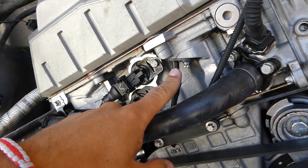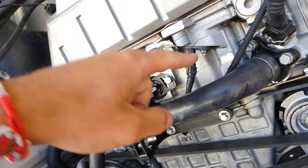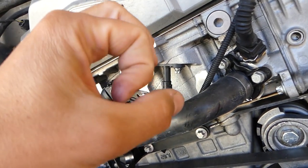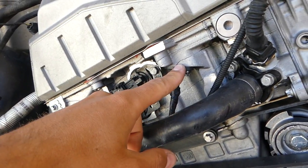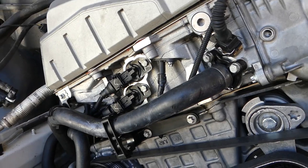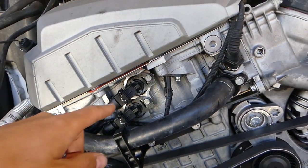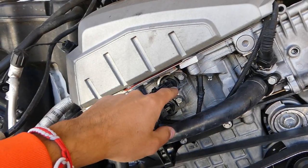After that, you can see this is the camshaft position sensor on the intake cam, and this is the exhaust camshaft position sensor. When you remove that sensor there is an O-ring — a little seal — that often starts leaking. Those are replaceable and very inexpensive; you can buy the whole kit for the whole engine.